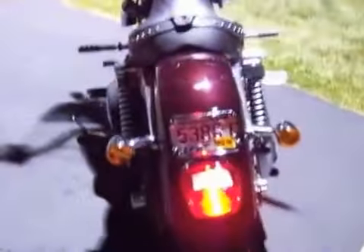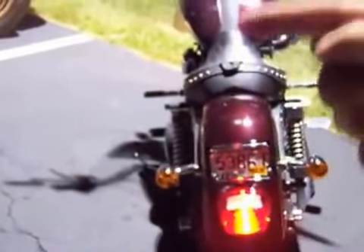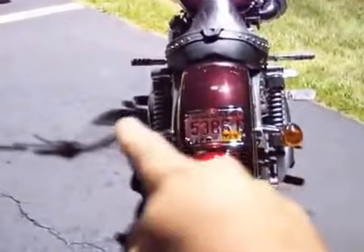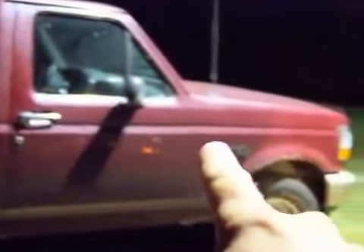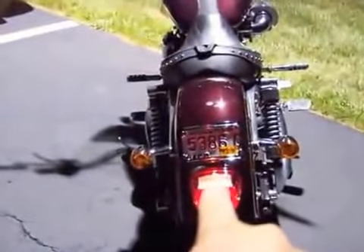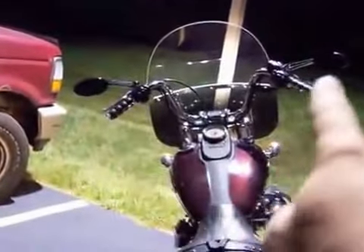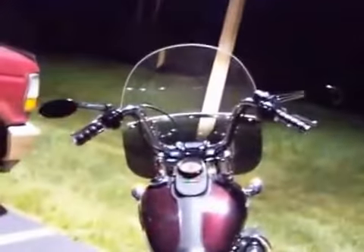Something to think about: SUVs. I was recently rear-ended. My turn signals are down low and I have a trunk on my motorcycle — it happens to be the same model as a Street Bob. A lady rear-ended me because she had a hard time seeing my left hand turn signal and my brake light. Safety feature — get them up where they can see them. As you can see by my truck parked next here, I'm up higher than the field of view on this motorcycle. If you were right in front of me, I would not be able to see your brake lights or your turn signals. Get it mounted up high. Turn one on again — everything works off the stock switch. That turn signal is going to stay on, and as you can see, if I was in a truck behind you, I would have no problem seeing that you were turning.